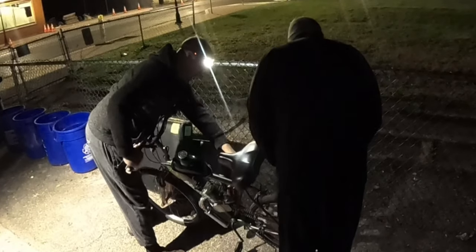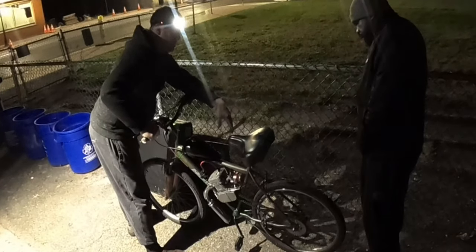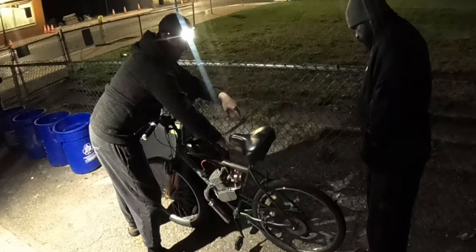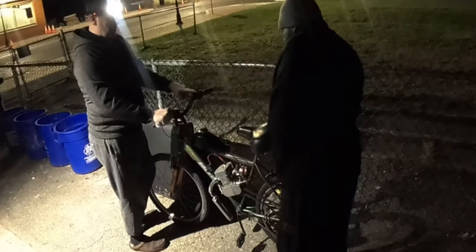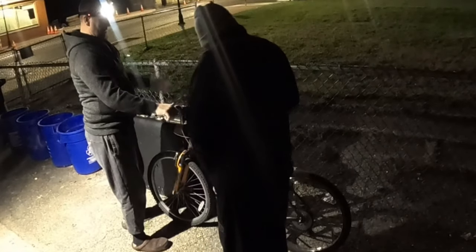brand new derailleur in the back. They changed the gears. I also put a 7-speed. It used to be a 5-speed. Still no front derailleur, but now you have 7 gears in the back to play with, and a brand new derailleur, because your old derailleur was just getting chewed up in the teeth too much. I changed your rear shifter. It's now a thumb shifter up here. So for your derailleur, it goes all through here. Nothing else on the neck anymore. And I put new cables on and stuff like that.